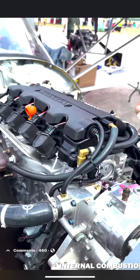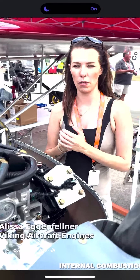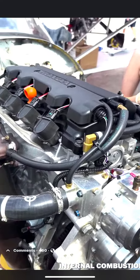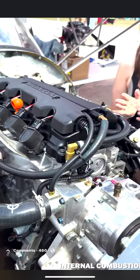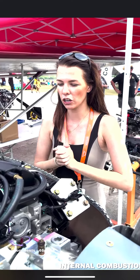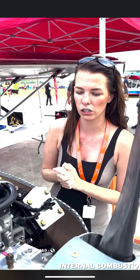We do auto conversions. We've been doing the Hondas for about 13, 14 years now, and it's been a great success for us. This one here is our 1.8 liter, 150 horsepower, and it comes out of the Honda HR-V. It's a port-injected engine, and we change out the wiring harnesses to a tough-cell aviation-grade wiring harness and our own computer. Where the magic happens is our gearboxes — that's something that's been well-proven in our design and great for all of our horsepowers.